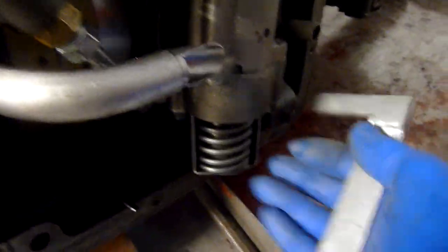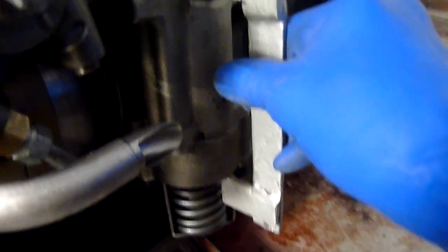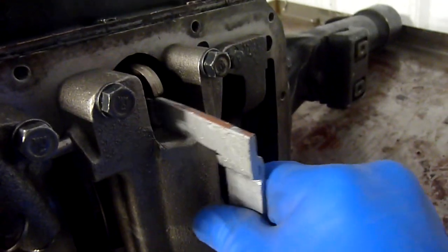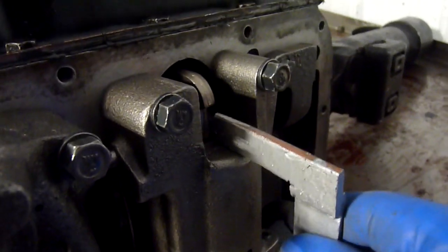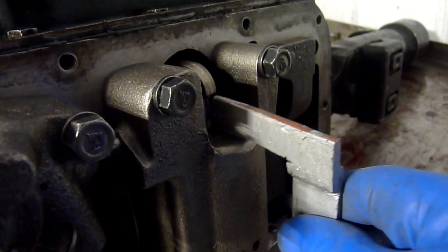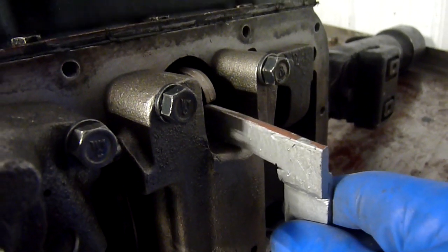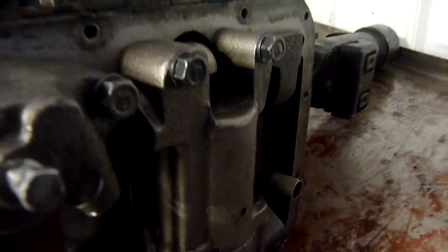Here's the rear servo, and here's the one edge that you use for the shorter portion, and the upper portion is here. I'll have to adjust that screw here, which will then push down on that lever, as the band pushes up against the pin that's into that lever. And then it can just make contact, and it's adjusting.